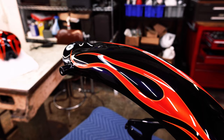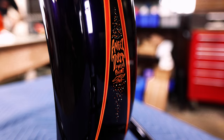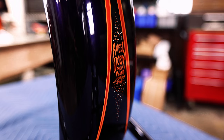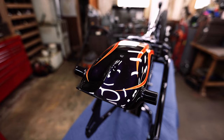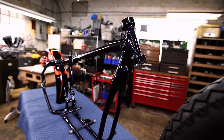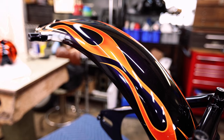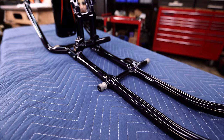So now that we got everything back, we're gonna start assembly, and this is the more exciting portion of our project, because this is gonna be closer to actually riding this motorcycle, but it can also be more stressful because it is painted nice, and you gotta be really careful. So I'm going to walk you through some tips and tricks so that you can bolt this thing together the easiest, but then also clean off paint in areas so that after you torque everything up, your bolts and all your fasteners will stay tight the longest without the paint making things come loose.